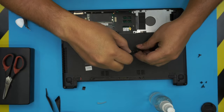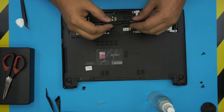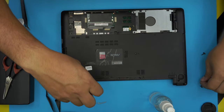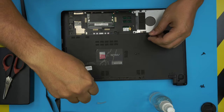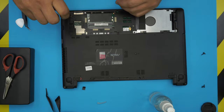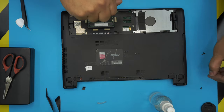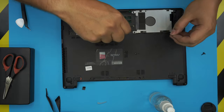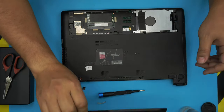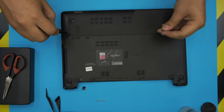Put the longest screw on the DVD drive area if yours has the longer screw there. Put the rest of the screws on the cover, except for the ones that go under the bottom service cover. Grab the bottom cover, put it in an offset position, slide it all the way in, and put the last two screws on top — and that should be all. I hope you guys liked this video and it helped you through your own service and cleaning for your ASUS laptop. If it did, click the like button — I really appreciate it. If you have any questions or requests, leave them in the comments and I'll always try to answer as soon as I can. Thanks for watching, and I hope to see you guys in my next video.